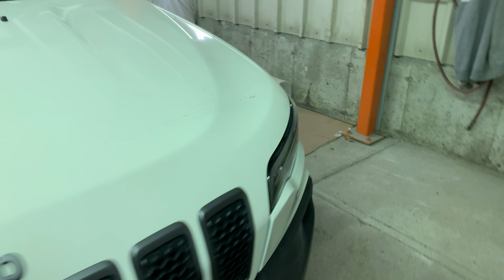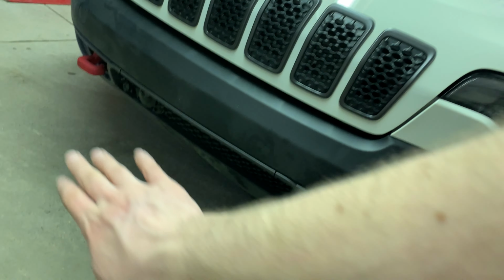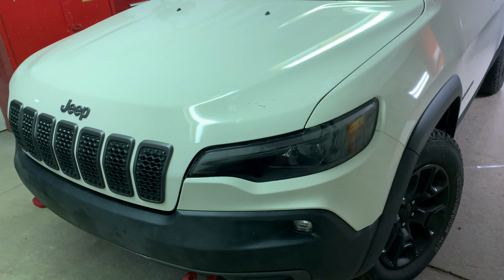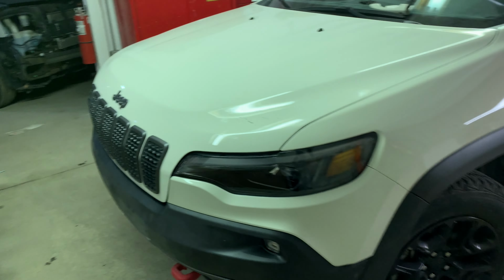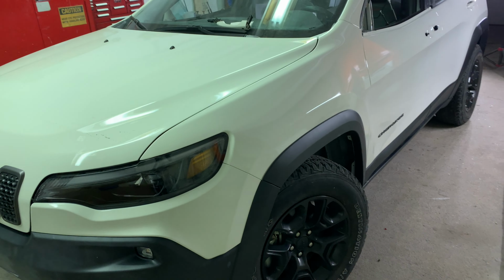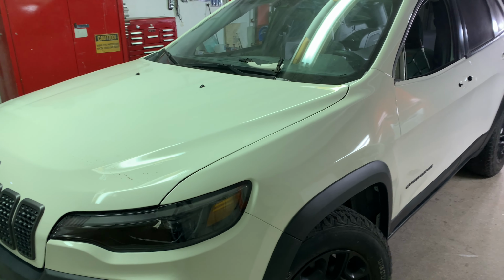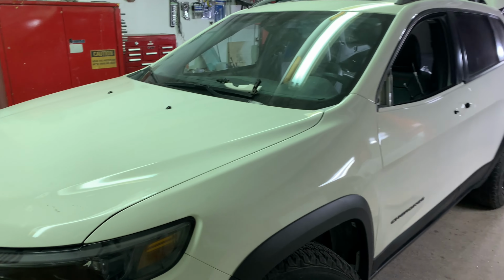Next, I'm going to go in and check all the parking sensors and the adaptive cruise radar in this. That module is going to need to have a proxy alignment done so it comes back online after being disconnected. And once we get that done, we should have all the lights on the dash cleared aside from the blind spot where we have the mirrors out. But the mirrors are a quick install. I'm going to actually get that next, do the belt moldings, the mirrors, and the glass in the front doors.